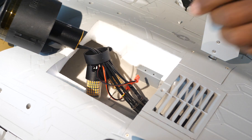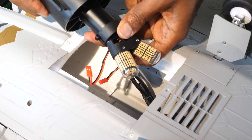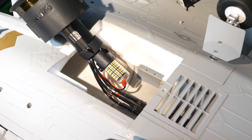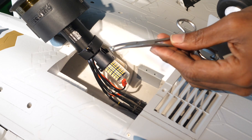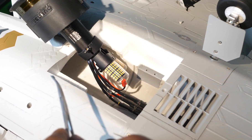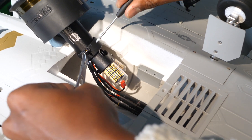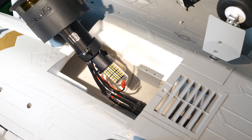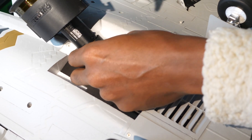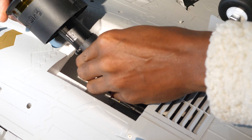All three leads have been passed through the motor mount or the light mount. So now we should be able to fit the light mount over the back of the motor. The only thing left to do as far as mechanically securing it to the plane is using a very small nut and a very small bolt. So we're going to feed the bolt through the mount, hold the nut on the other side with the clamp, and just tighten that down — just enough to snug it for right now. We're going to release the clamp and I'm going to put a little bit of glue on the motor to add a little bit of additional security to keep this thing from sliding around. Then slip this more into place on the motor and tighten it down the rest of the way.